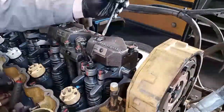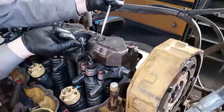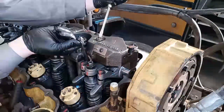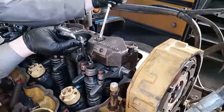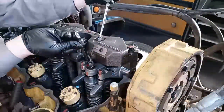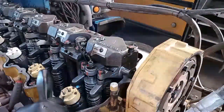After waiting 30 seconds for the oil to push out, slowly back the adjuster off. The reason you go slowly is that if you overshoot and it gets too loose, you have to do the whole procedure again — over-tighten and wait for oil to leak out. So slowly turn it, waiting for movement in the feeler gauge. Once it gets close, turn even slower to get just a light drag, then run the lock nut down without changing the adjuster.